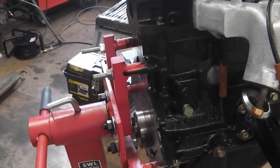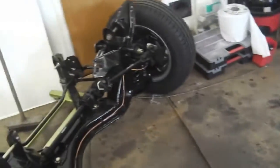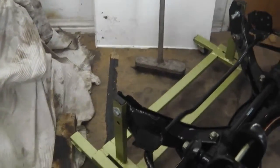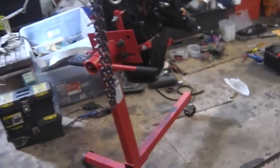Right, I'm happy with the ignition setup, so I've got the fuel on and the carb on. What we're going to do next is put the engine on to the clip and just trial it out, so we can get the flywheel on. I think I'll be able to bolt the flywheel on while it's on the clip, rather than try and do it when it's swinging around on this thing, because obviously the engine crane's in the way. So let's get it off the engine crane, and then let's lower it onto that clip and see how it takes on the clip. Probably see the suspension should drop down a little bit. That front subframe I built should pivot as the engine drops, and it'll slightly draw the dolly slightly underneath the clip, which should be okay. Let's see how it all works. It's going to be interesting, this, how it looks in the clip.